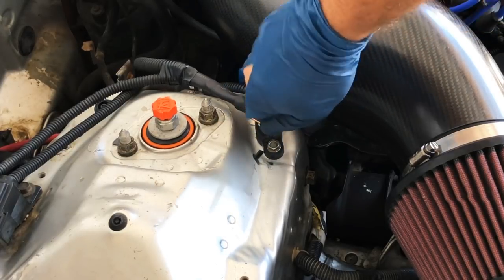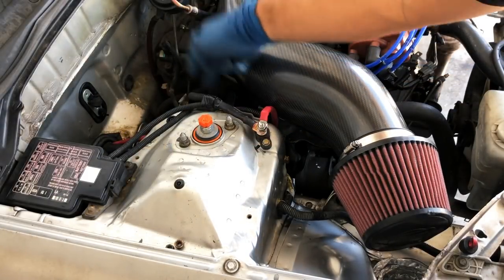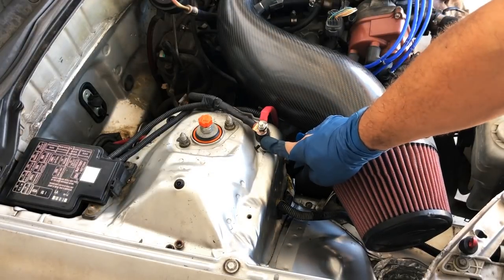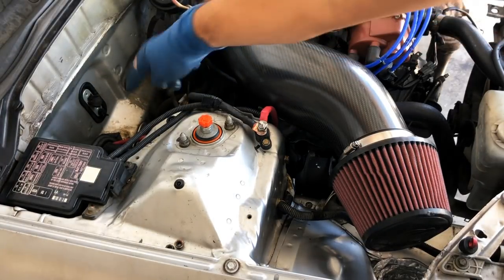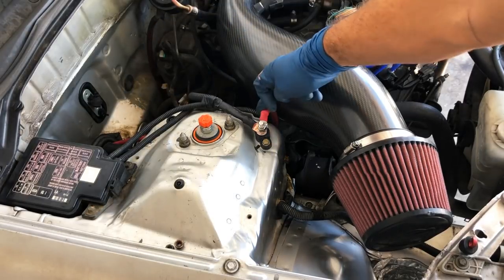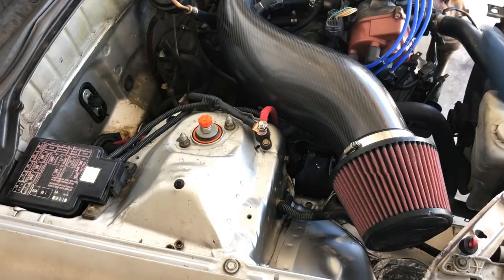I just put a nut on the top so everything is secure. Okay, so I have the fuse cable and the power to the starter going to this power terminal, and then I ran my power cable for the battery through the grommet back here for the main wire loom. And then I've connected it here as well, tightened the bolts down, and good to go.